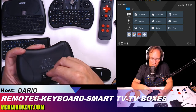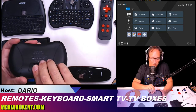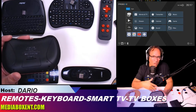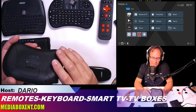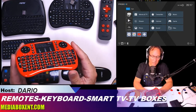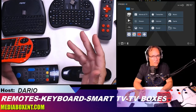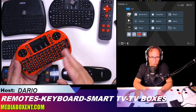A lot of people complain this doesn't work on some devices. I tried to sync it into my Pro X2 — it found it but would not do anything. It may have to do with the operating system. On Android 6, it did not work; 7.1 I'm not sure about. I can guarantee it works on the Nvidia Shield and on any PC or Mac. The USB dongle is only for PC, Mac, and Linux. This is still a good solution — it feels good and that's what I use for Bluetooth devices around the home and for the Fire Stick.